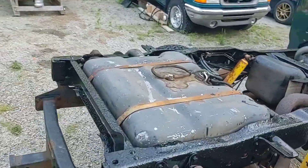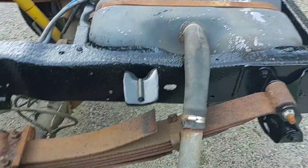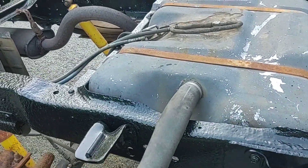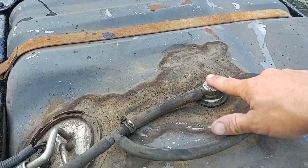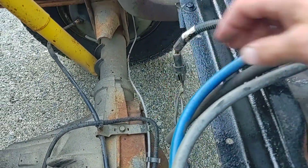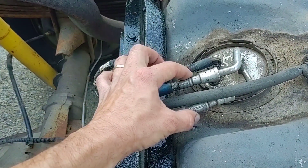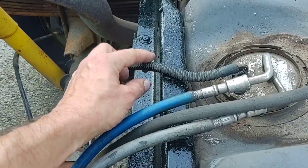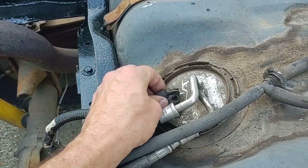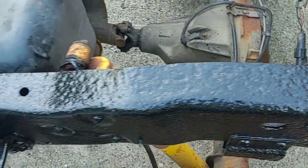We're fortunate the bed is off my truck right now so you can actually see the diesel tanks — this truck has dual tanks. Here's my rear fuel tank. The filler neck goes from metal down to rubber. Up at the top of the tank is a vent fitting — it's an open system because diesel doesn't really produce a lot of evaporative emissions. This piece is known as the fuel sending unit — there are two lines here, one is a feed and one is a return, so fuel comes out of one and comes back the other. On a more modern vehicle the fuel pump would be electric and inside the tank, but on this older diesel the wires are just for the sending unit for the fuel gauge.